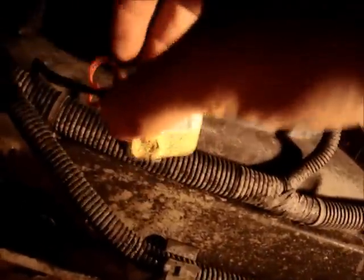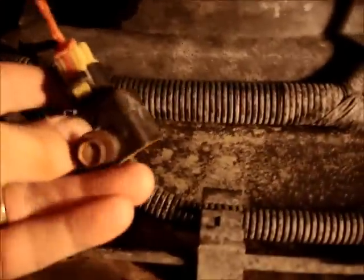The other one is underneath the other side of the radiator, right up there. This truck is pretty rusty. Here's the sensor after having removed the bolt — it's a 10mm bolt which comes right out, and the sensor will just fall right down. I got the original airbag sensor off and it's just kind of dangling right here.